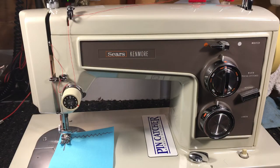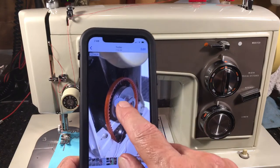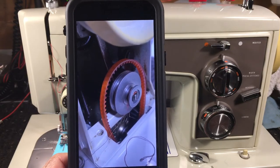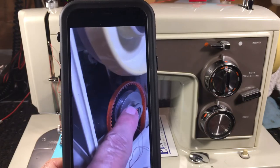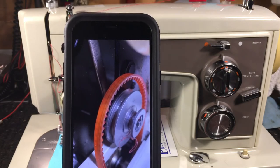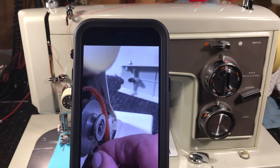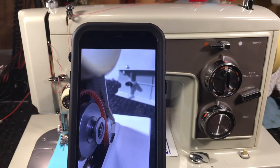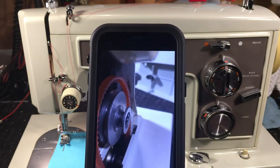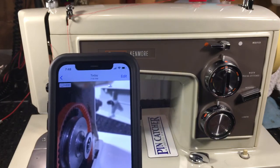After checking the motor brushes, we check the belts. When you're replacing the bottom belt, you oil the idler and make sure it's freewheeling. While you're at it, look to make sure there's no thread wrapped around it, because that's going to cause a problem. Get that off so you have a good gripping surface for your new belt. These are little places you've got to know to look to head off problems.